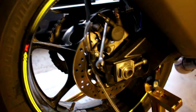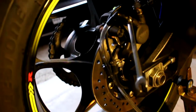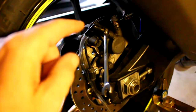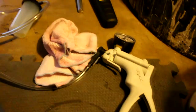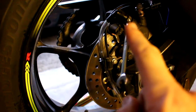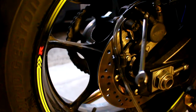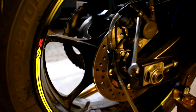You already saw me do the front — do the same thing in the back. One thing to point out: don't worry about whether this is going to be completely filled with brake fluid — that's not going to happen, and there's a little bit of physics behind that. You don't need to see the brake line solid with brake fluid when you're using something like a MightyVac. It's pulling brake fluid through so fast that only so much can pass the tiny bleeder screw opening. When it hits the wider brake line it leaves space — that's vacuum space, not air.